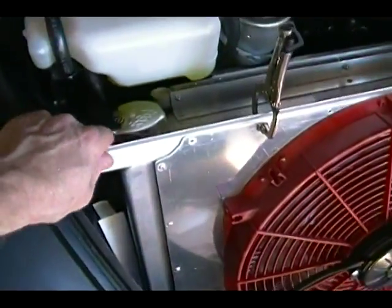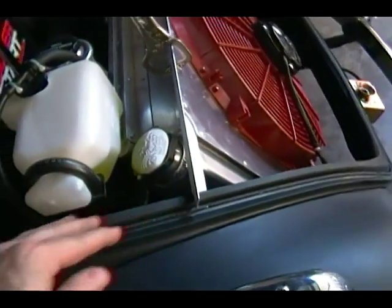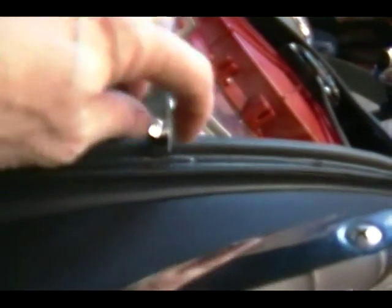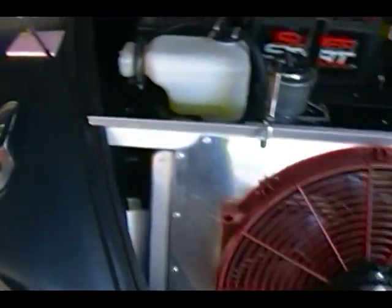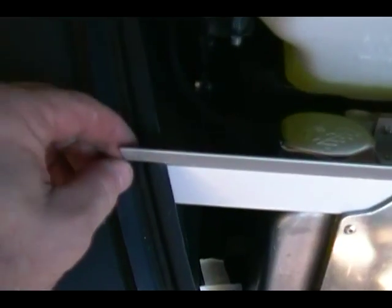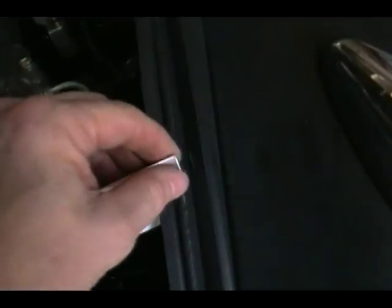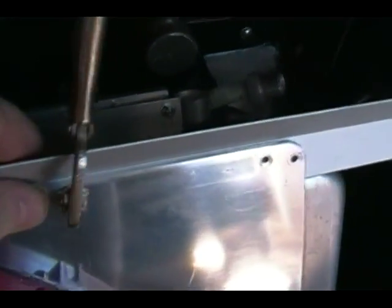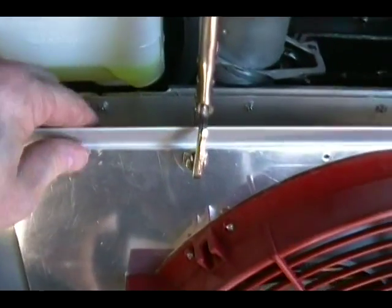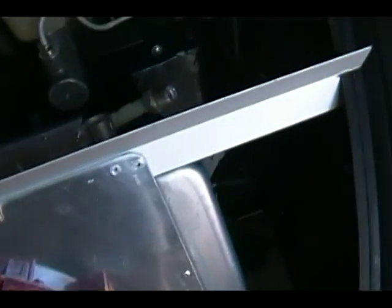Right here I've got this piece of — it's a 135-degree extruded aluminum angle. You can see it's kind of 90 degrees to the tangent of this curve right here. So I'm going to build a little panel here to block off the hood. First I want to get this piece of metal in here to come over the edge. I'll probably take about 3/16 of an inch off of this side and 3/16 off of this side so that it slots in and clamps on. I drilled these little rivets out and I'm going to go ahead and put little number six screws back through all of this to hold it all together.